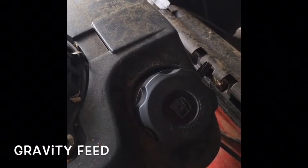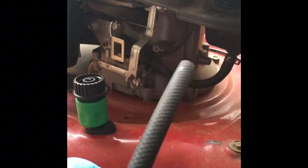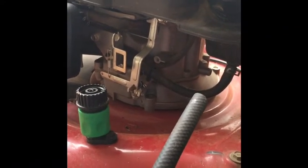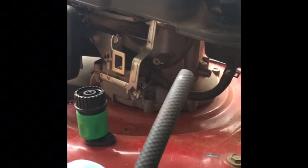I've got an extra piece of hose here — I'm going to stick this on and have it drain into this Folgers container. I'll first disconnect the fuel line, hopefully not too much gas will come out right away since I have the mower tilted. Then I'll let it drain until it stops. If it stops and there's still gas in the tank, I know it's the gas cap. If it drains the whole thing, it's something else — or maybe cleaning the gas cap already helped.